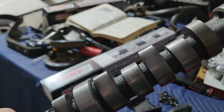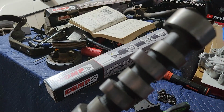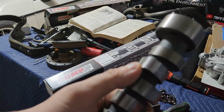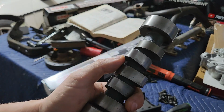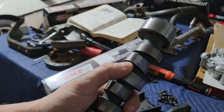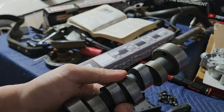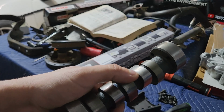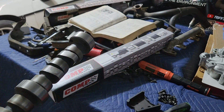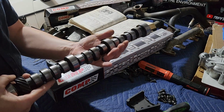But the more you look at it, I just start getting nervous and nervous. Most notably, this one. So we can get it to focus. If you look, there's actually a tiny bit of chipping there, and you can see the surface is almost slightly gouged. It's a little rough. It's possible that this cam was on its way out when that engine failed.